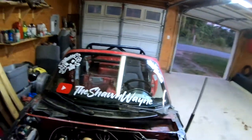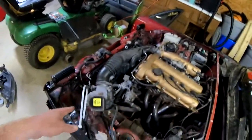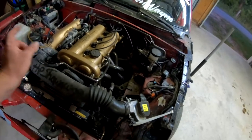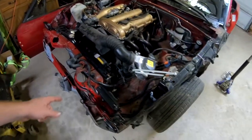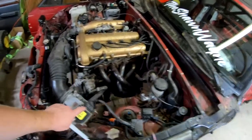What's up boys, we're getting ready for the Gambler 500 coming up this weekend. Got my Gambler stickers on. I ran into a problem - I drove this thing the other day and the hose clamp gave out on the radiator hose and blew water everywhere. So I'm going to replace both hoses and raise the radiator up, like we did on the Focus.